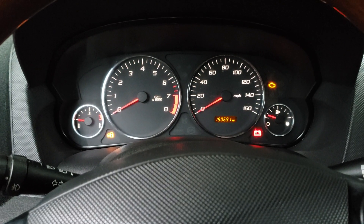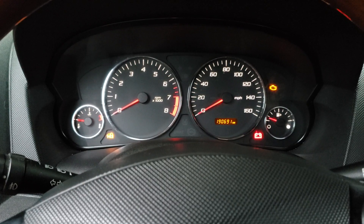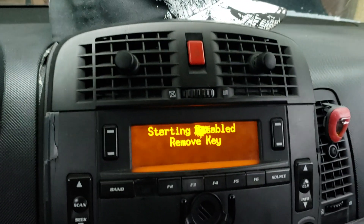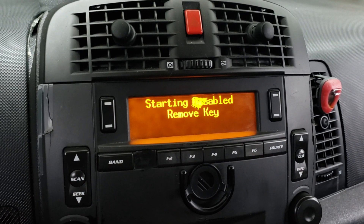All right guys, last final seconds of the third round on this — the light should go off in almost any second now. Like I said, if your dash pops up with that after you replace your old ECU with the new ECU, you should have that, and you do have to do the key recycle to have the new ECU learn your key.